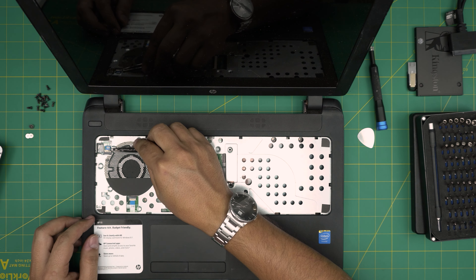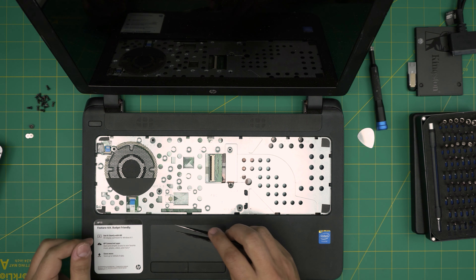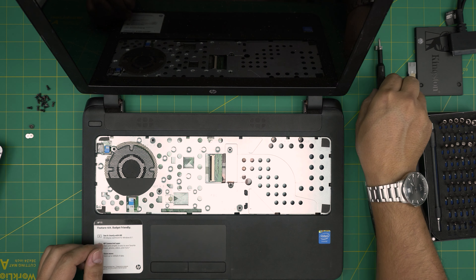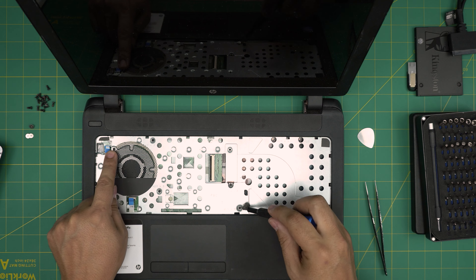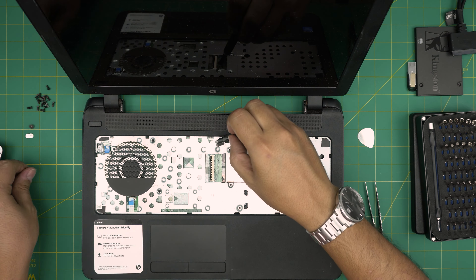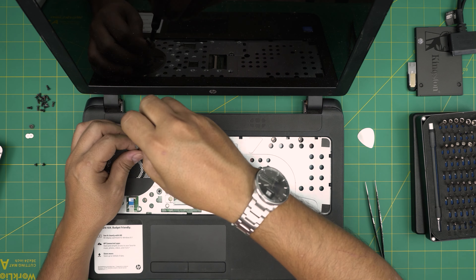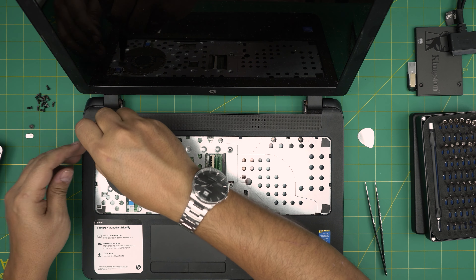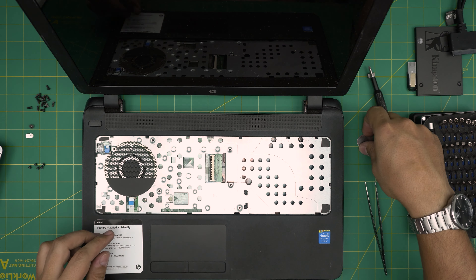Use one finger to lift up the next hook, then use a tweezer to pull back the flex cables. Now remove five screws on the palm rest — one, two, three, four, five. I don't know why they do this — they could have made it easy with a tiny cover on the bottom like the RAM cover, but they don't want people upgrading their laptops, so they make you go through the whole process.